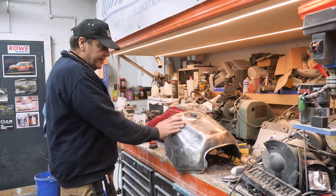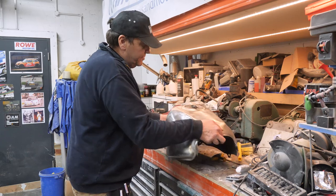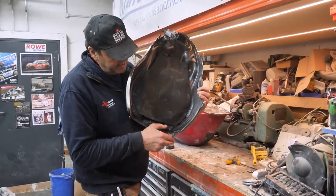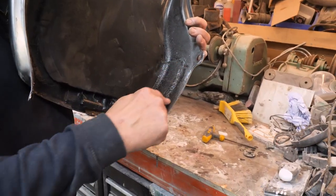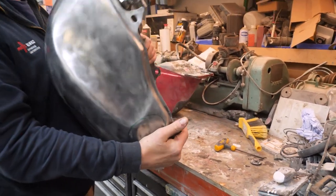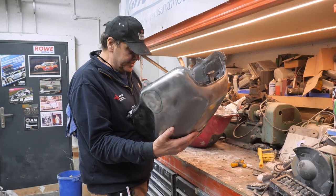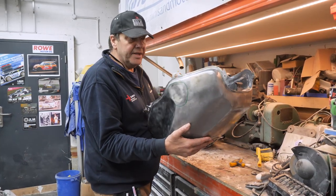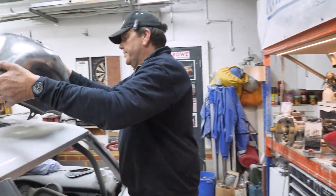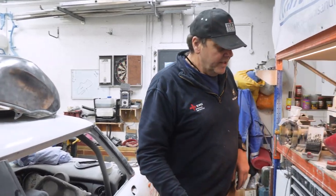It's come up really well, hasn't it? Yeah, considering. Obviously there's a bottom to do. We've got to do underneath as well. Was there a repair on the bottom? Yeah, look, just there. See it? So I might not strip the bottom. I don't think the bottom needs stripping. I think it just needs sanding and tightening up because it's just been painted raw. Got to be straightened up, primed. I'll just prime it and then paint it when I paint all the other bits.